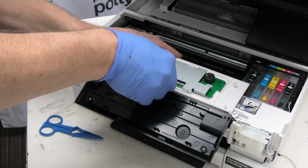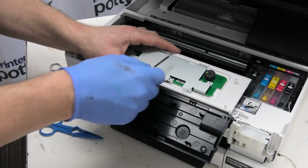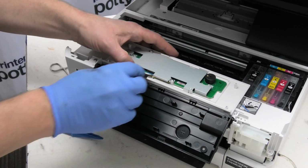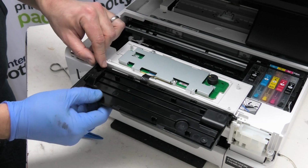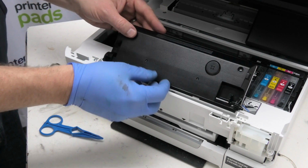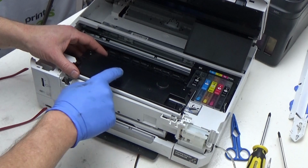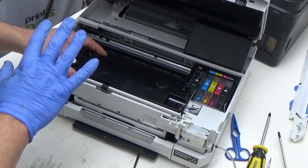What you may find is that you actually have to get your thumb on the back of the cable to support it, holding it in, while you then flip the little catch down like so to hold it in position. Okay, so that's now got it. So now what I'm doing is I'm rotating this out of its holding position and carefully manipulating it back so that it matches up with our front panel. With the cable into the slot and this back panel back in position, you then need to put your 4 screws back into this back panel to secure it.